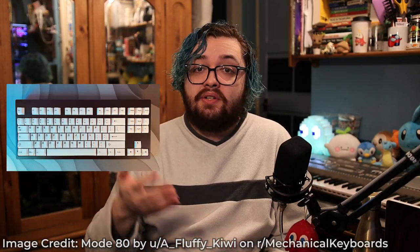The switches here sound less pingy and slightly deeper. However, the scratchiness described earlier is still prominent in the feel, due to the switch materials inside the Cherry switches. Once these switches have broken in, this can subside from what I've read online. Speaking of the keycaps you salvaged from your old keyboard — you can use them, yes, but you have to pay attention to the keyboard layout you are using. If you're using a TKL keyboard, most of those are going to work. But if you're using a 60% or 65%, be cautious about the layout there, because that uses a 1.75U right shift.